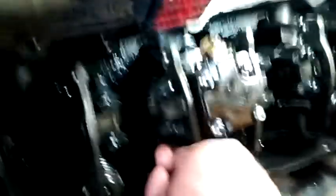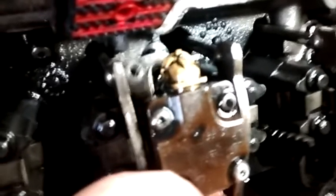I really enjoy working on these engines — this is my favorite diesel engine of all time. I like the reliability of them, the ease to work on them. They're pretty simple to work on for an electronic engine compared to a lot of the newer stuff. So you got your bolt out. Now if you pay attention here, this metal bracket will slide back — see that? What that does is it frees itself from the bolt on the back. So like I said, you didn't have to touch the back bolt.